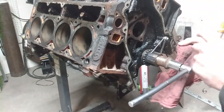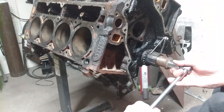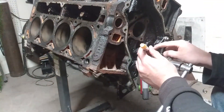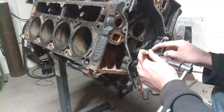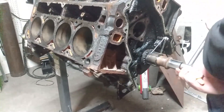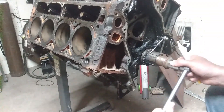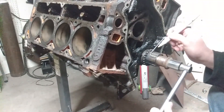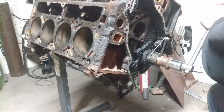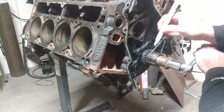Let me clean this off so I can get a paint mark to stick. So top dead center on this - at the piston stop again - put a mark there. Now we have two marks, right? We have one mark there and one mark there. That one's going that way to that mark, and this one's going that way to that mark.